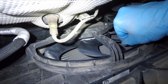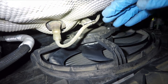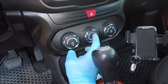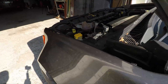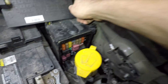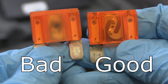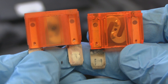The fan can be wobbly and probably was noisy when it came on. It can also be hard to turn. These are the signs that it is failing and should be replaced. If it doesn't come on when the engine runs hot or when you turn on the AC, check your fuses. If the radiator fan fuse is blown, replace the radiator fan — don't try to just replace the fuse, it will blow again.